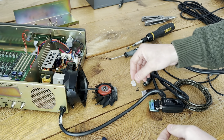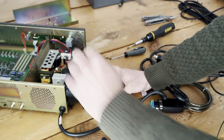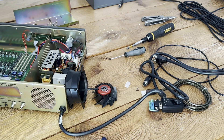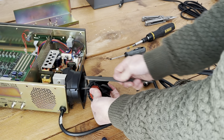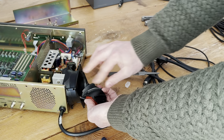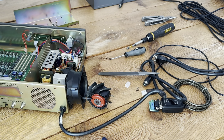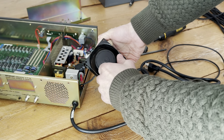I had to take the screws out of here, and there's also a grounding strap connected to the fan — there's a green wire that was attached right there. Let me take the screws out and show you what it looks like once I pull that apart. Fan is apart. Two things I had to do: remove those screws, and also remove this little clip so that the wire could move freely. Now I need to file down all these fan blades. I saw some people did some scoring on the inside too, but I'm going to try filing these down a little bit and see if I can solve the problem.